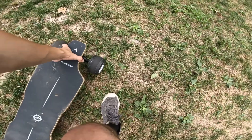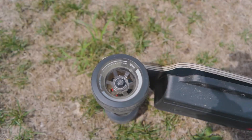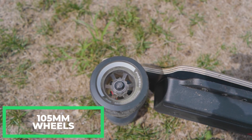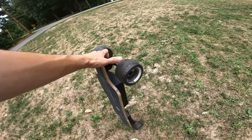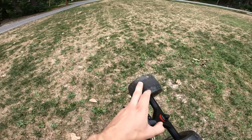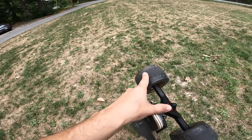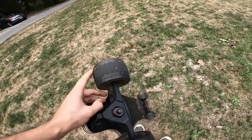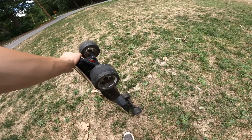The first thing about this board you might notice that's different from the other boards I've tested is that this has much larger and more textured wheels. These are 105mm wheels. Most of the boards I review are like 90mm wheels, so these are a lot bigger, and they have this kind of hexagon pattern on them, which has very much worn away in the middle where the real contact patch is. So I wouldn't expect this to last a super long time, and they do help with going over more rough terrain, although I wouldn't consider this an off-road board at all.